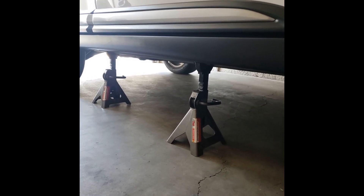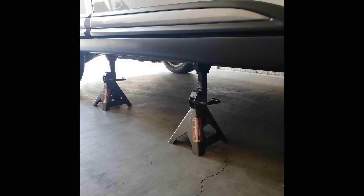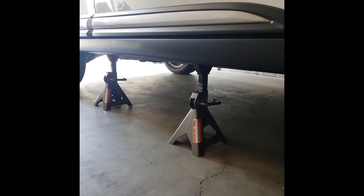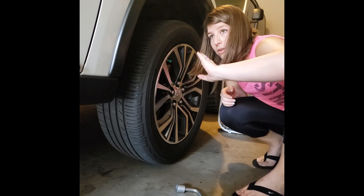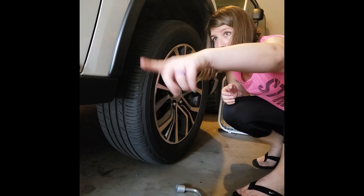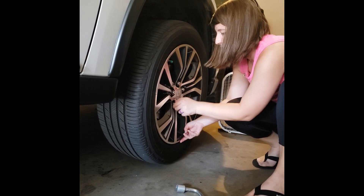Now we've got to jack the car up. Just like with the oil change, since I'm going to put a jack stand, we're going to jack it up here and then set a jack stand to keep the back tire off the ground. You can see that the car is on the passenger side on both jack stands. Now I'm going to jack up the other side because what I like to do is cross the rears to the front and bring the front straight back — that's how we're going to do this rotation. I'll take off the front tire and then the back tire on the passenger side. The front right goes straight back to the right rear, and the right rear goes to the front left. Once you get these loose, you can just twist them off with your hands.